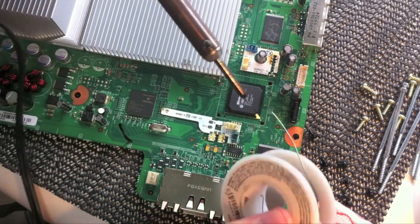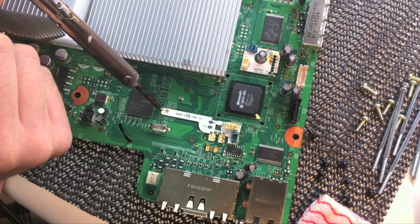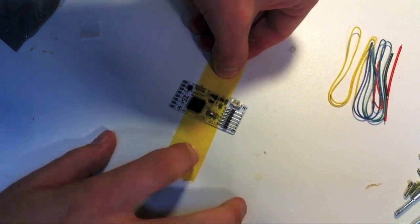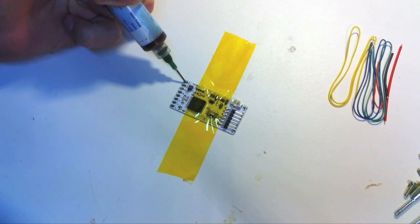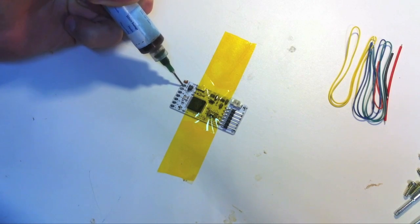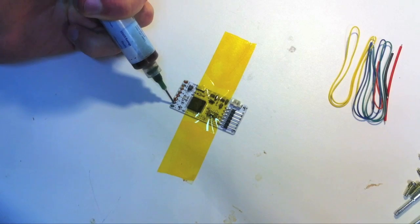The connection to the HANA chip is five traces down from the top trace. This has been noted for many users as being the trickiest point to solder. I usually tape down the CoolRunner to my bench with some Kapton tape so it doesn't move around. All you have to do is flux the pads on the CoolRunner chip — you could use a Q-tip with RadioShack Rosin Flux, but the Tacky Flux syringe is easier for me.